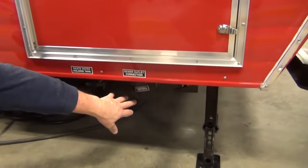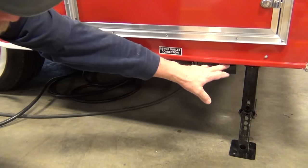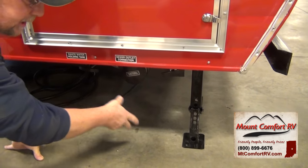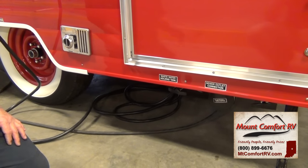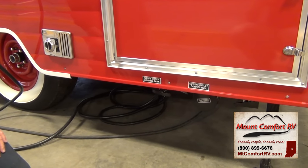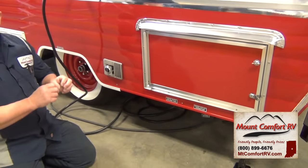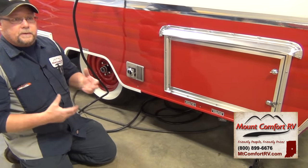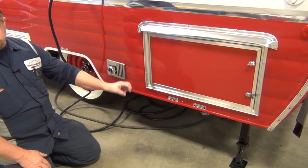Right down here you have your termination valves. The smaller valve on the left is the gray water — that's your sink and shower. The sewer outlet on the right is your toilet, what we call the black water tank. Twist the cap off, put your sewage hose on, and always dump the sewage first. These are pull valves — you pull out to open and push in to close. Dump the sewage, close the valve, then do the gray water — that rinses out the sewage hose and the tank. If you have a permanent hookup at your campsite, leave your sewage valves closed, because if you leave it open your liquids go out but your solids and papers start stacking at the bottom of the tank. You want to build up enough fluid so that when you dump, everything flushes out. Always dump the sewage first, close the valve, then dump the gray water.